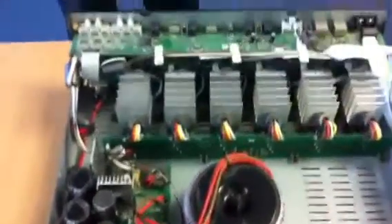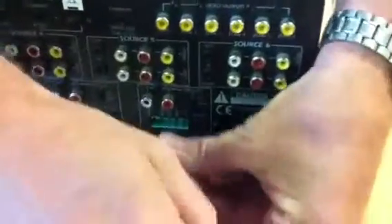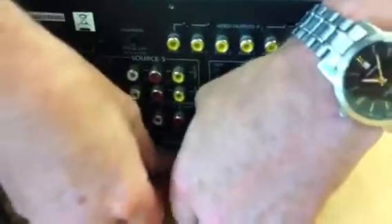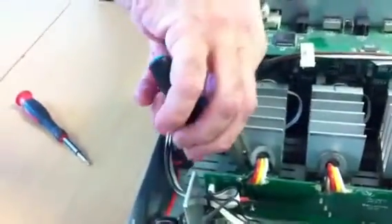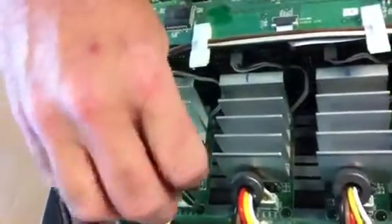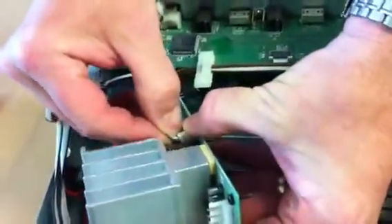This is now very easy to do. Looking at the back of the unit, I'm going to take out this module here at this end. We need to unscrew these two screws which hold the module onto the back panel. Then inside the unit, we'll use a pair of thin nose pliers to disconnect the speaker cable. Pull it out of the way, then two screws here. Pull the module out and disconnect this one here.